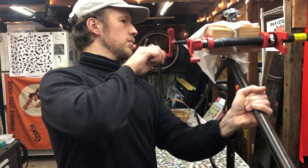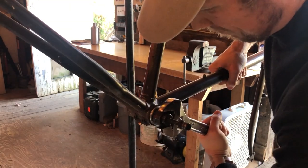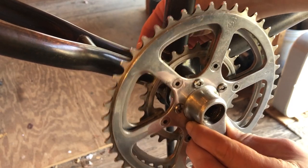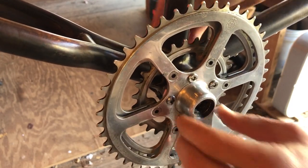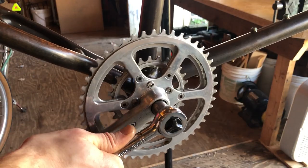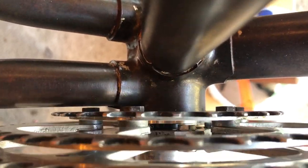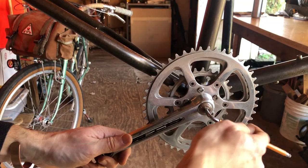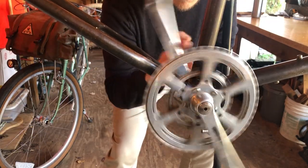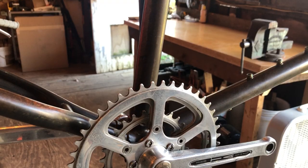I've got the frame on the stand. I started with a cheap Shimano bottom bracket — this is a 115. This is a TA Specialties crankset; it's a triple ring, but I only plan to use the two interior rings. It's 170mm length on the cranks and a 48-42-26. Nice tight clearances with the 115mm bottom bracket. I also had some nice TA crank caps. I've seen Peter Weigel get these down to raw brass — I tried to remove the chrome plating, but I was not successful.